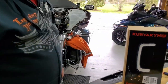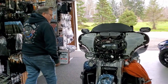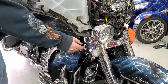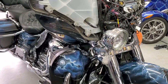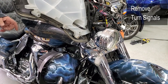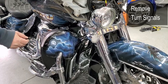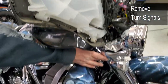The first thing you're gonna do — we'll show you on this side — you have to take your turn signals off. Inside there's a connector; we'll show you on the other side that's taken apart. You're gonna unhook it, put a Y adapter in — it's a breakout — and then plug your new LEDs into that.